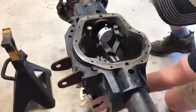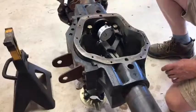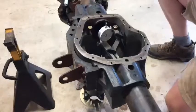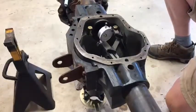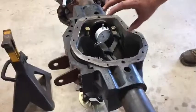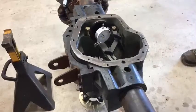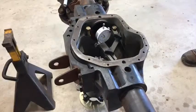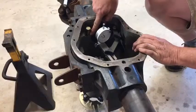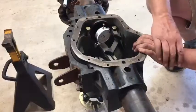Spinning the pinion slowly, I confirm there's no big variation — the pinion is running true and flat, which is good. I take measurements on both sides and average them since they won't be identical. My preferred method is photographing the gauge reading with my phone so I have an exact reference rather than writing it down. The measurement is from the flat bolt surface down to the gauge, and then we'll calculate how close we are to 5 inches.